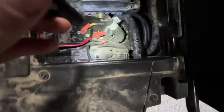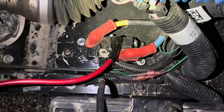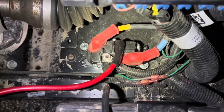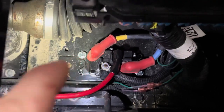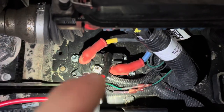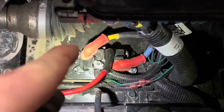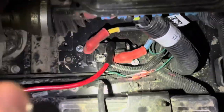So all that's missing is a solenoid. You'll see this item right here as we go down in there — this item right here is going to be linked in the description below. Quite easy to install. There was a good spot right there just on top of that skid plate, and I just put two zip screws — one there on the bottom right corner, another one back here using an extension on an impact. And then on top, those are 10-millimeter bolts that you can tighten down. All the colors are on there — tighten down all the wires from the factory. Then what's missing is this positive lead that then hooks to your battery, and that's a half-inch on that end. I'll link it in the description with all the parts.